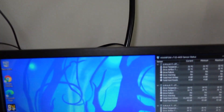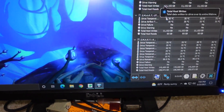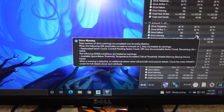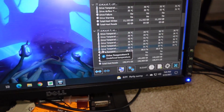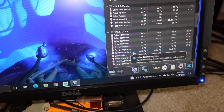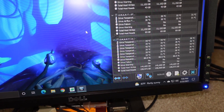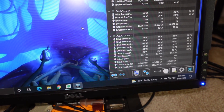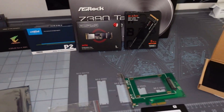It's very important that you guys are keeping an eye on the life expectancy — knowing the overall terabytes it can write, but also monitoring it. As you build plots, make sure you're keeping an eye on things. Keep an eye on temps too — it's really hard to keep some of these fast drives under a good temperature unless you've got a good heat sink or airflow. Just make sure you're keeping an eye on its life and not running it ragged.